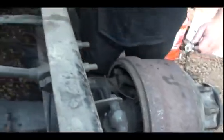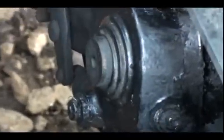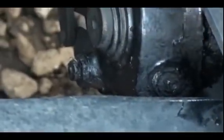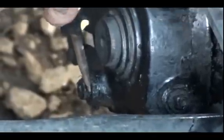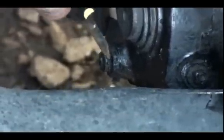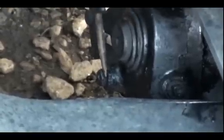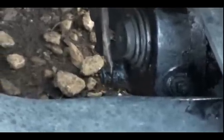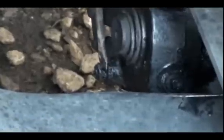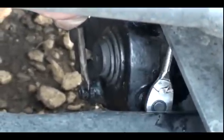But this one here, his truck is a little older. He's got one of these. It's got a lock where you can't turn that but one direction, which means it only makes the brakes tighter, and I need to loosen them. So he's got a little thing down here. This little thing is a release, so you can turn it the other way. You just get a flathead screwdriver, put it on here like this, and pull it out like that, and it's got a little spring on it. You got that? And then you get in here with your ratchet, and you back them right off.